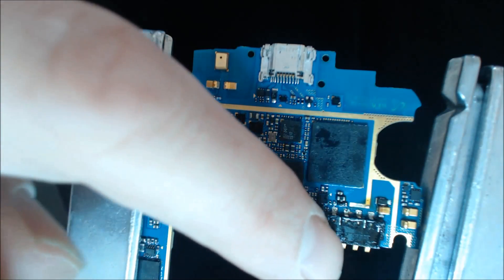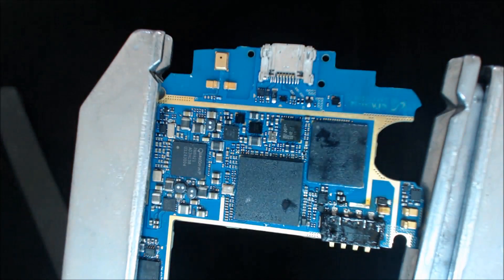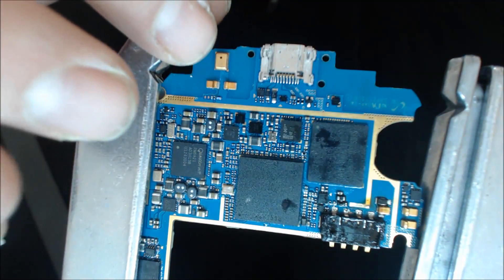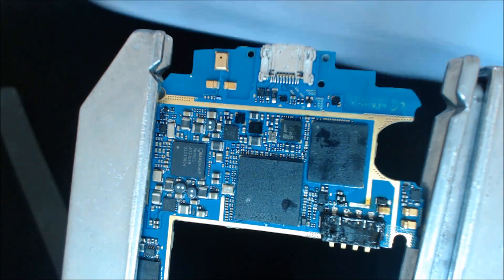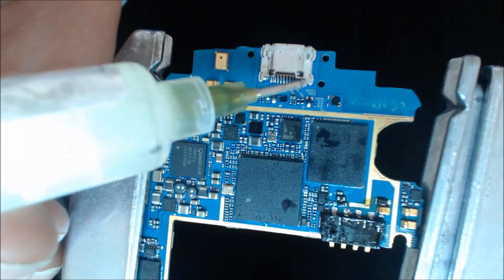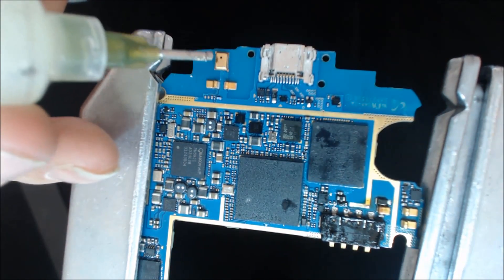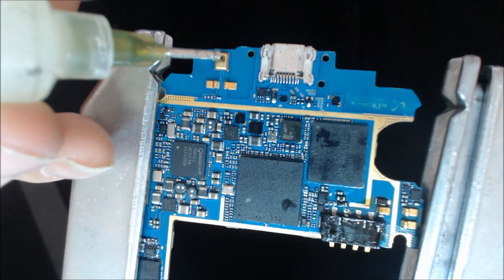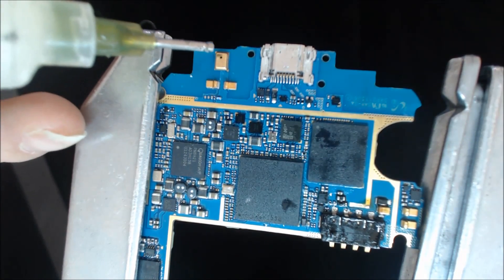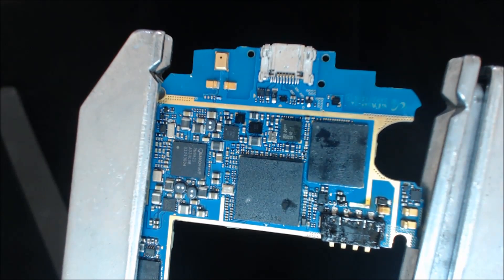Please excuse this damaged area right here. This is not what your battery connector should look like — this is a damaged board. However, I will show you exactly how to replace the microphone. We replace the microphone all the time, many times when you actually replace the port here. If you get flux around this area, or if it gets any kind of liquid in there, it pretty much ruins the mic. So I'm just going to show you how to take this mic off and put a new one on.